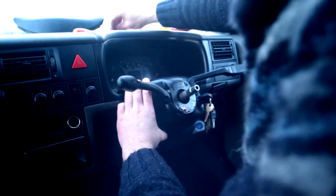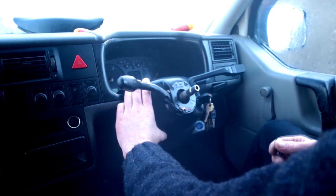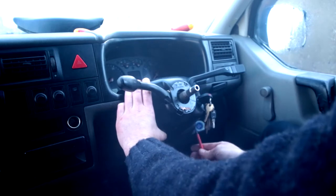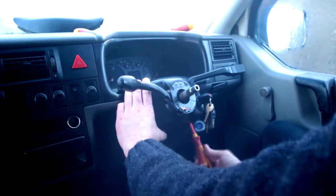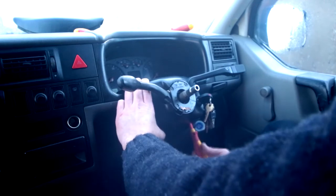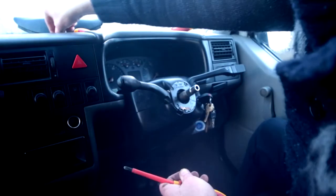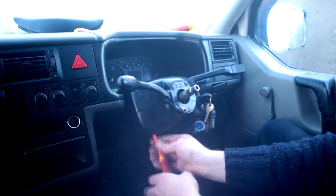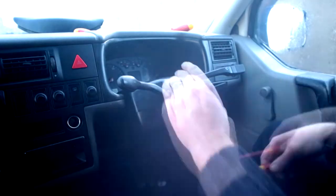And it pays to have a magnetic screwdriver for this. This is just a Phillips screwdriver. The magnet helps just keep that screw in place while you're holding the console. Just tighten to a pinch. Don't over tighten again because it's all plastic down here. It can easily break. Now your console may have more screws in it. There's only two in mine, that's the way I got it.